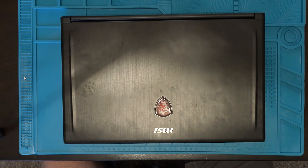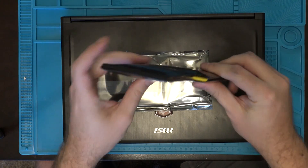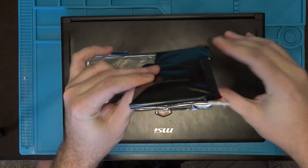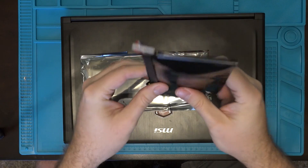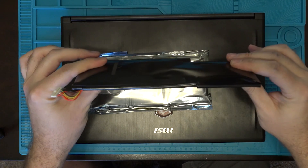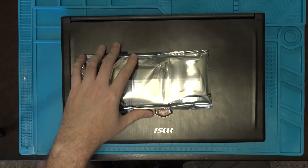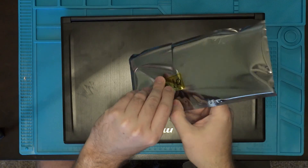Hello there! I'm going to do a quick video on swapping out the battery in the MSI. My laptop here — I've already opened it up and removed the old battery. As you can see here, it's expanded quite a bit. The actual keyboard was raised up because of the expansion. And because MSI doesn't make the batteries, I had to go on eBay and get one from China.